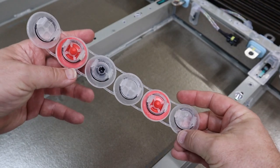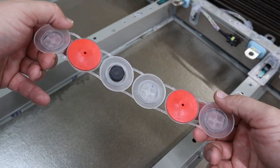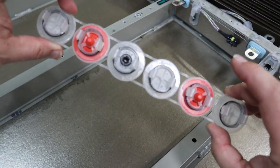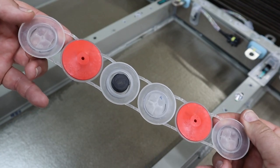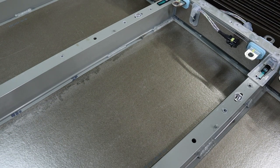Here's a better view of the new part. You can see it's a strip and it's not just one component — it's not just those orange umbrella valves. It's three plugs, two valves, and then the one with the black dot in the middle. That's the Gore-Tex breather, which just allows air to go in and out, but not moisture.